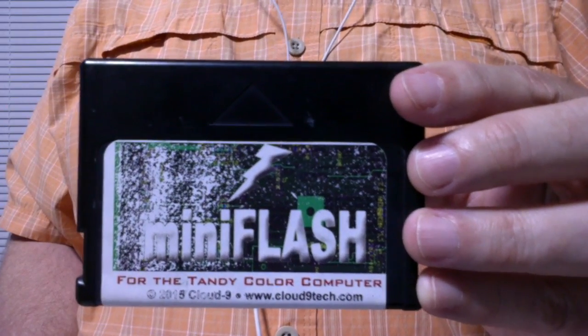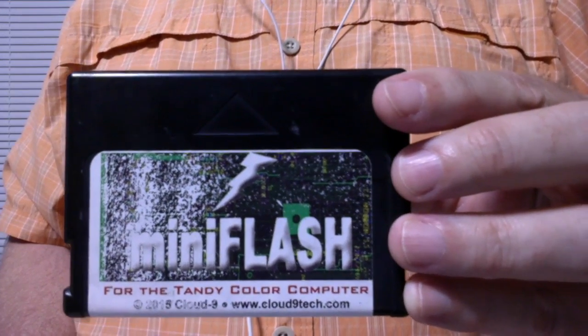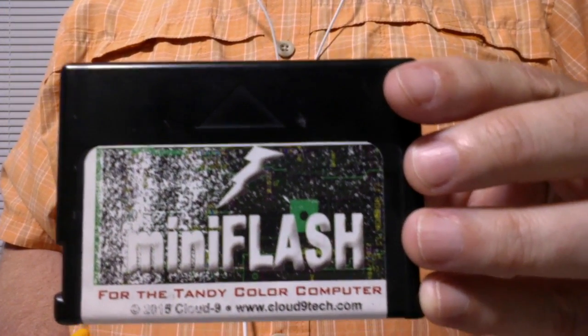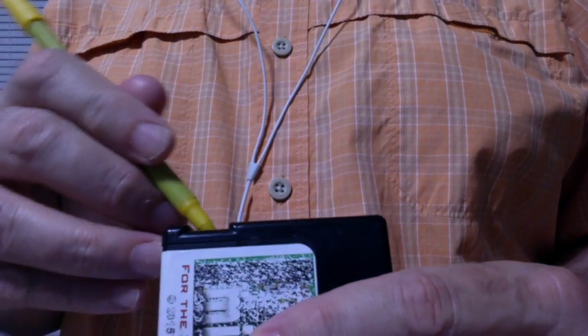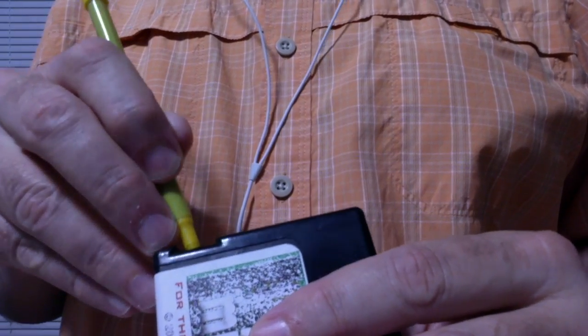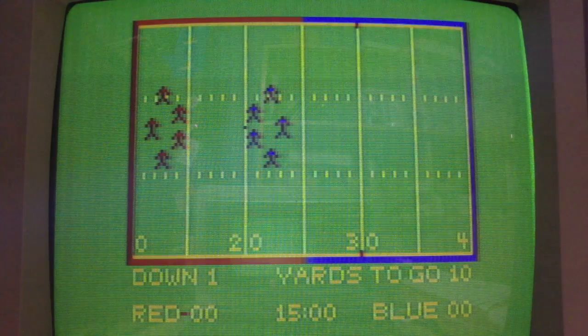Now I'm going to change the dip switches on the miniFLASH so that it will automatically start on Bank 0, which was our football game. And because football is a game we want to auto start, we're going to also enable dip switch 1 for the automatic start for the cart line. So we'll set dip switch 1 to on, which is enable, and then we will set the other two, dip switch 2 and 3 to on, which is Bank 0. Now that the bank switches have been set to Bank 0, I've actually enabled the auto start so that it should automatically start what we put in Bank 0, which was football. So when we power on the Coco, there you go. It automatically starts football.